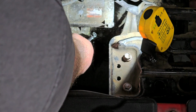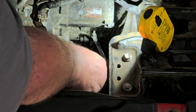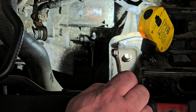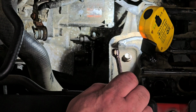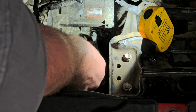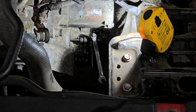As you can see, we're using the small wrench because it's just easier to get in here. Oh, there, see all the foam coming out of it? That means it's air. And we're not going to go nuts tightening it with a 12 point. All right, pump it up again. Down. Okay. And as you can see, there's a lot of foam in that. And that foam is basically air.